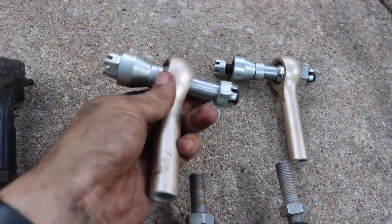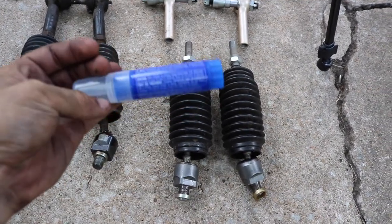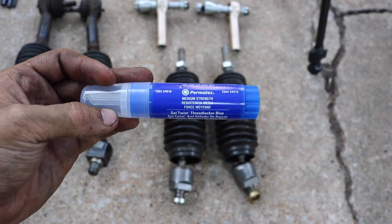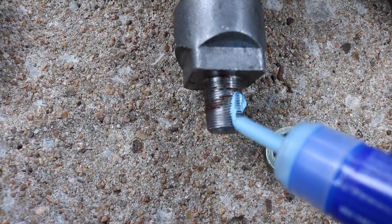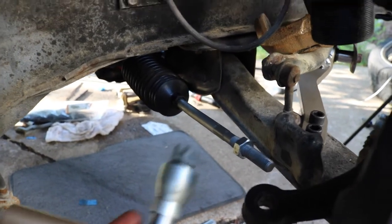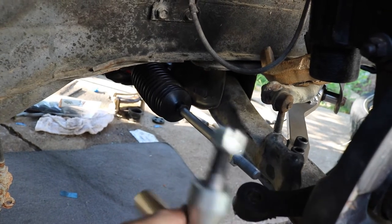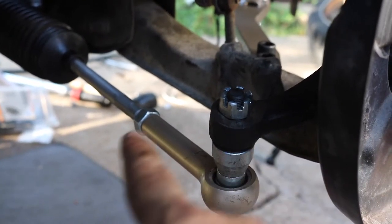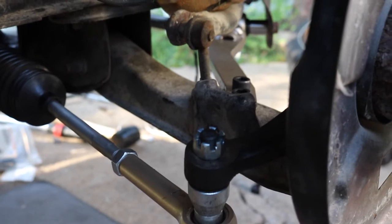Either way they're solid and they're going to be great. One thing you want to make sure to do after cleaning off your threads is to apply a little bit of blue thread locker to make sure the tie rod doesn't go anywhere. I'm using blue so I'll be able to get it off with hand tools - if you use the red stuff it may take a little more effort. The inner tie rod is now installed - next is the outer tie rod, which threads onto the inner and is seized down with that nut, then bolted to the hub. Both tie rods are now installed, just need to tighten down the two nuts, put a new cotter pin in, and we're set. These tie rods should pair nicely with our new offset tension rods to give us just a little more angle.